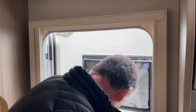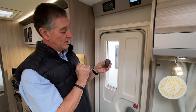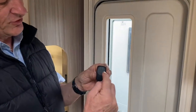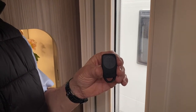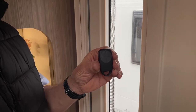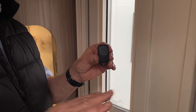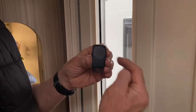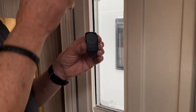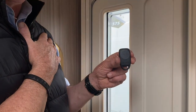To explain the remaining alarm buttons: the top left arms the alarm, the top right disarms it, and the third button activates the alarm but not the passive infrared — so you're taking out the passive infrared detection. This is useful if you have an animal inside the vehicle while you go out, as you can isolate the PIR while keeping the tilt sensor active. The awning light also illuminates for a 30 second period when any of those buttons are pressed, to indicate externally that you've activated or deactivated the alarm system.